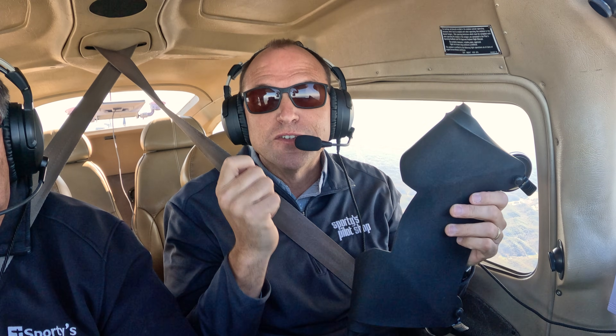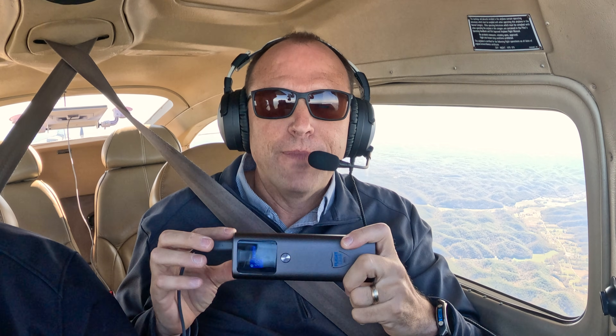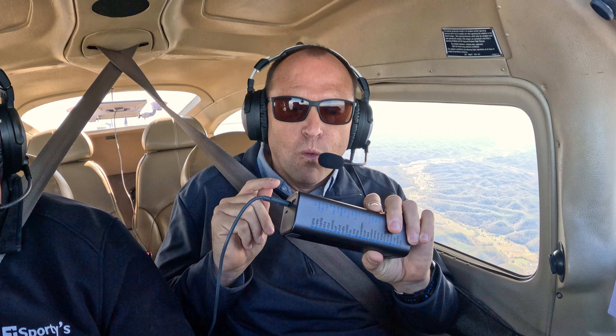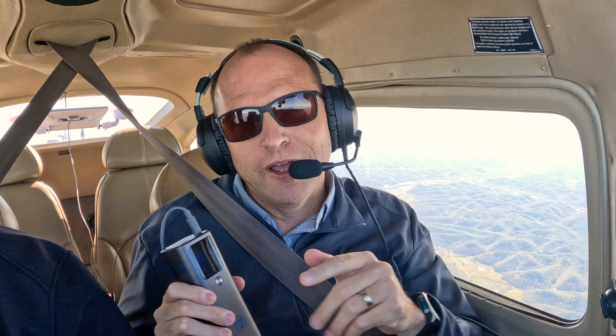You'll have to play around with it to see what works best in your airplane. I do think as more satellites get up in the atmosphere, reception will get better in different positions. The other thing you're going to need is power to that Starlink Mini. My favorite battery bag for this is the Flight Gear Max. It has over 27,000 mAh of juice, and the screen tells you the draw rate of the Starlink Mini plugged in. I found that 10,000 mAh per hour is a good average, so this battery brick will last about 2.5 hours. A great feature of using a battery brick is I can simply unplug it to turn the Mini off, and I'm not drawing power off the aircraft system.